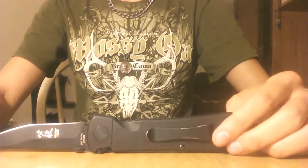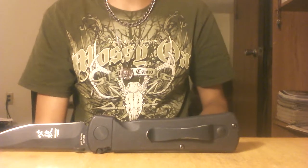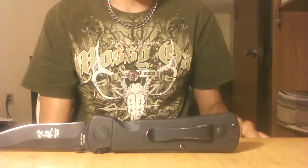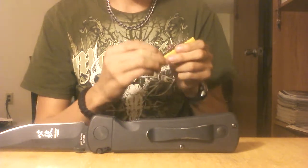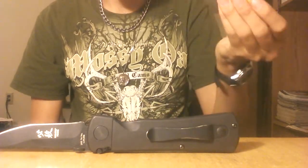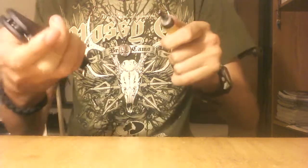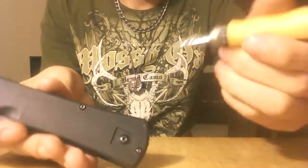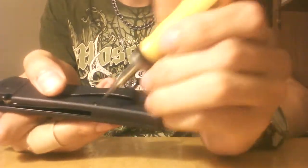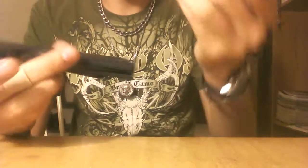And let's get started. I have noticed that a lot of YouTubers tell you how to take it out, but no one that I've seen so far has actually shown you how to take it out. So that's where I'm going to come in. What we need is a T10 and a T6, and of course you need a Torx screwdriver. We're going to close that up right quick though. We're going to start with the T6, and all you got to do is take these two screws out, loosen these ones up, and loosen this up, and it'll be all peachy keen from there.